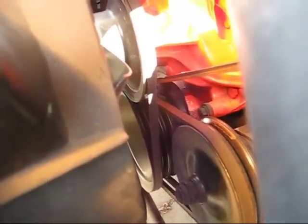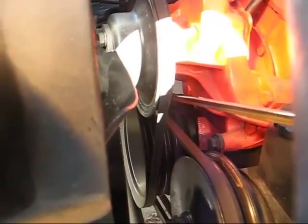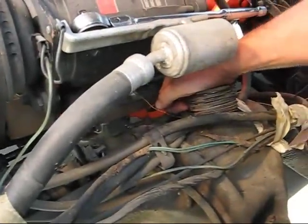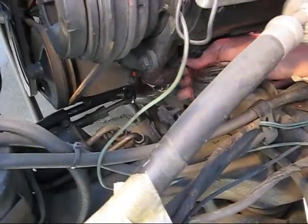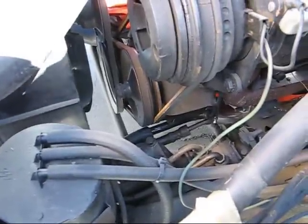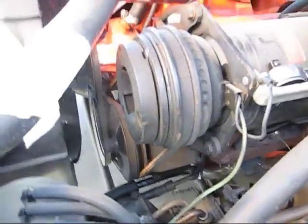It's gone past it — here's the line right here, so it looks like it passed it. Let's check by sticking this piece of bailing wire into the spark plug hole. We can stick it in quite a bit, which means that's 180 degrees out — not where we want it. So we're going to jog the motor and try to get it to stop on the other side.